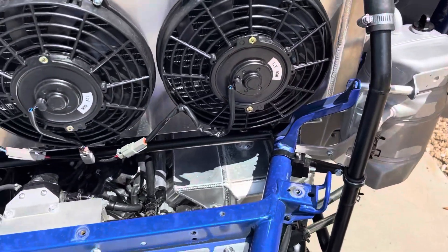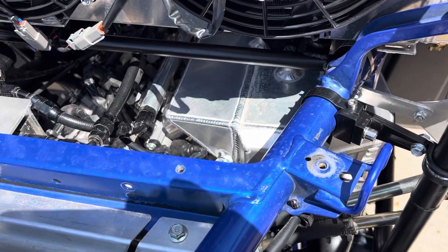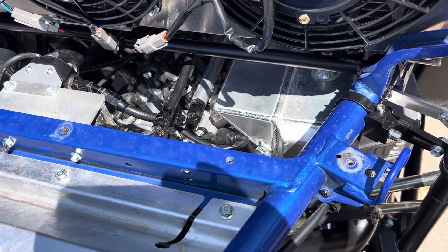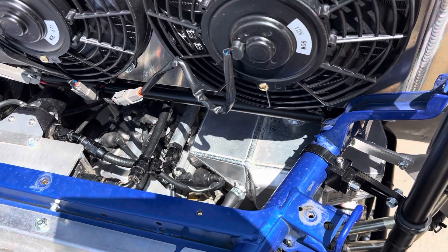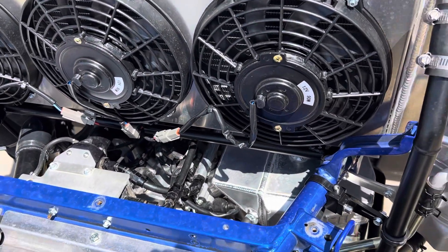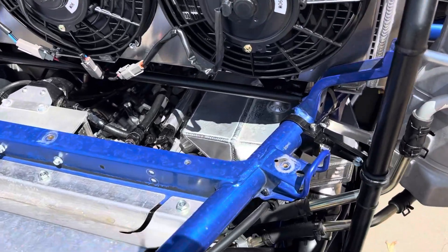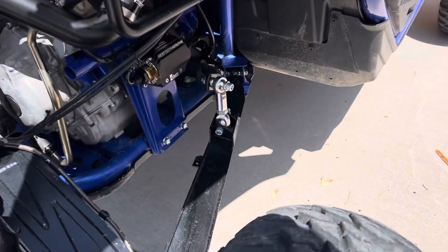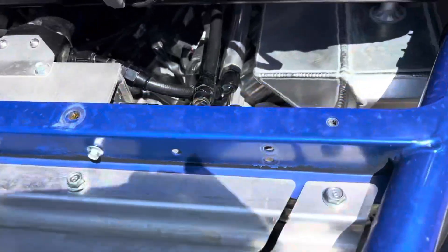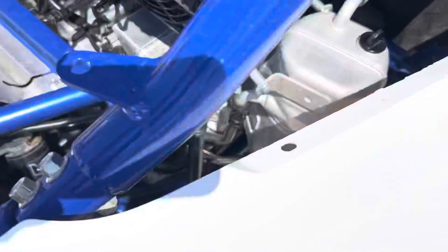For what we've done now: first thing is we did our water-to-air intercooler. The reason we did that is obviously it's a future-upgradable item — when he does put more power to this thing, this RPM kit used to have an intercooler right here vertically, basically where this radiator sits now. So we got rid of that and did our water-to-air. This is our intercooler — it uses the billet output flange with the internal O-ring.